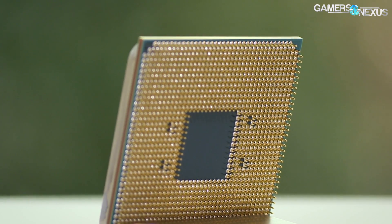We're overclocking, we're turning off SMT, and as a reminder from the 1700 review, we are also increasing the memory clock with the overclocked 1700. That means this is not a perfect A-B test. Our model was not capable of exceeding 2666 MHz without overclocking the CPU itself, so our testing compares stock at 2666 MHz versus 2933 MHz on the overclocked 1700. The point was really to push it with overclocking and see what is possible under better conditions, as requested by viewers.